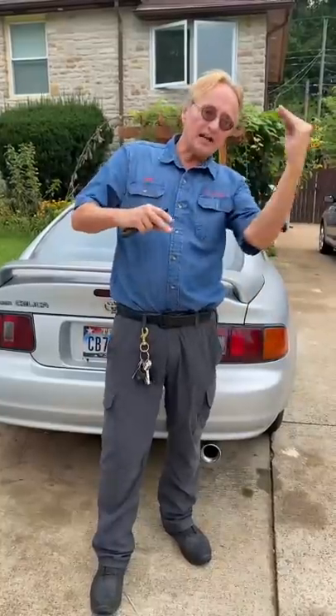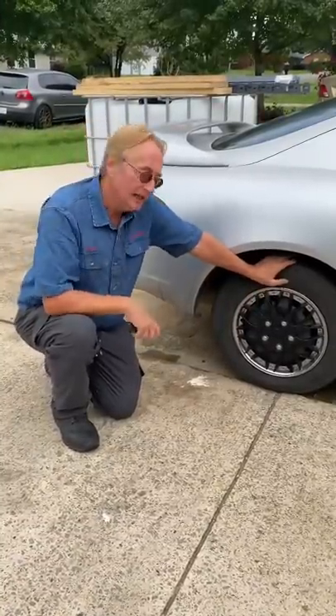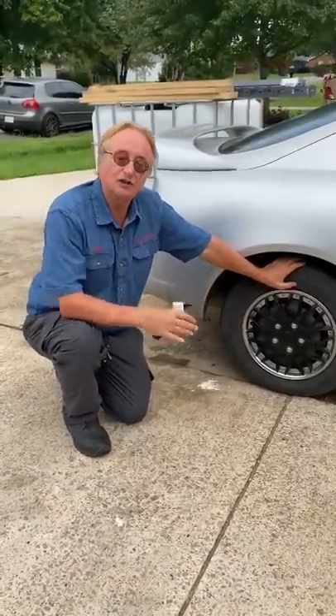And if only one side of the tire is worn on the inside or the outside, that means your front end alignment is off. And if your tire has bulges on the side like blisters, either you're whacking into curbs or you bought really cheap tires and they're just coming apart.